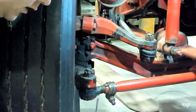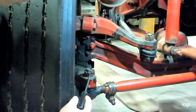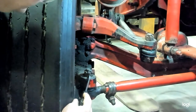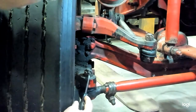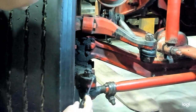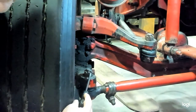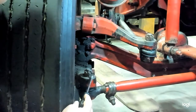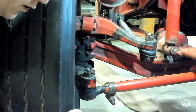For the fourth step, they tell you to make sure the tie rod end is properly torqued. Most tie rod ends are fastened with a castle nut, which requires the use of a cotter pin. If that cotter pin is still intact, you can be reasonably assured that the castle nut is still at the proper torque and everything is fine. If one comes in without a cotter pin, you're going to want to check the torque of that castle nut, re-torque it, and install a new cotter pin.